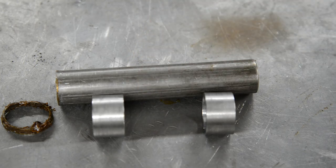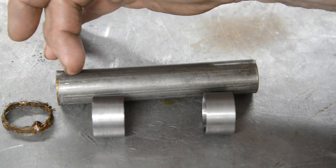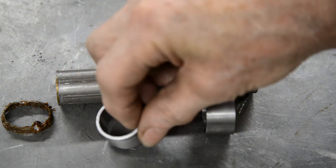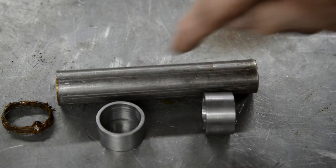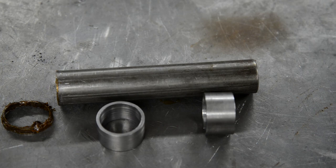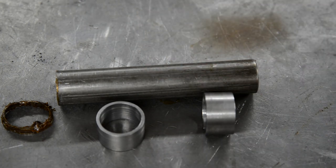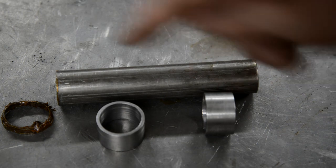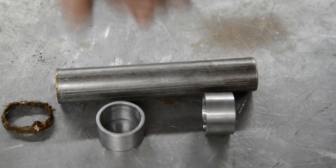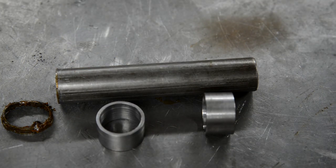Now what that does is twofold. One, it fulfills the purpose of this in that it stops the grease coming down here. Also, now it gives you a face rigidly mounted on this so that you can actually drive the bearings out. And then you just put this back in. All right, and if you look in the parts book, they aren't listed. It's shown, as you saw in the drawing, as having them just there. It's a one piece thing.